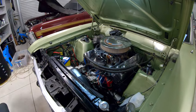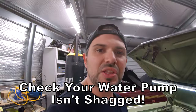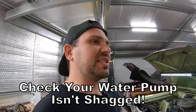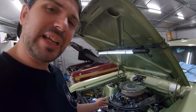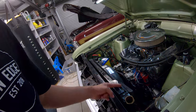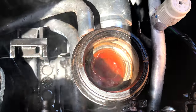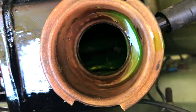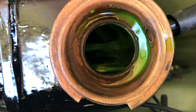Let's say you've done all of those steps, yet you're still having issues. The next thing I'll be pointing at is the water pump. There's a chance your water pump could be cactus. To verify whether your water pump's cactus or not, see if there's flow actually going through your radiator. Start the car with your cap off and let it get up to temperature. Once the thermostat's open, you'll see the actual water flow from one end to the other. If you give your car a rev, you might see the volume of water really increase as the water pump spins faster. If that's happening, it's probably not your water pump. But if you're not seeing any flow, it's probably a water pump.